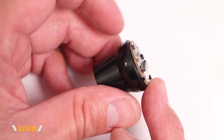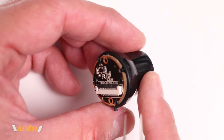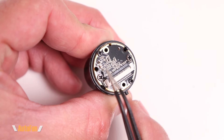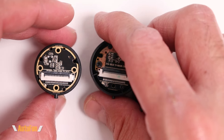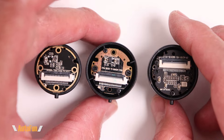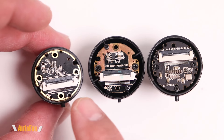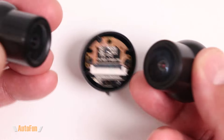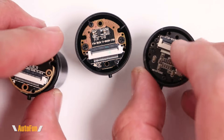Here's a close-up of the front camera assembly: the body, the main front lens — which can be constructed from a combination of plastic and glass — and the PCB that holds the image sensor. To get to the sensor there are a couple more screws. Before showing the sensor, I want to compare it to the AutoVox and Vantop sensor assemblies. Even though dashcams may follow similar design principles, all three sensor assemblies are different — different PCBs, different part numbers, and different tooling for the barrels and lenses.